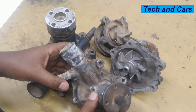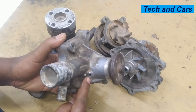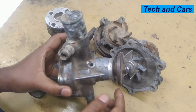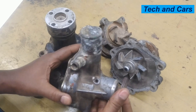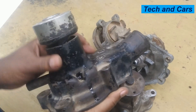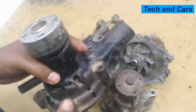Another symptom is coolant leakage. There are weep holes on the water pump — if there is damage to the bearings and bearing seals, water will start slipping out of these holes. There is a hole here and another hole here; if you see water dripping out of these passages, it indicates the seal has failed and the water pump is going bad. On this big water pump, you can see an even mark of coolant seepage due to a failed seal.